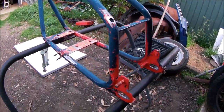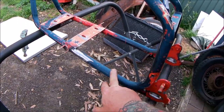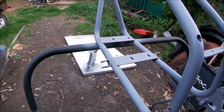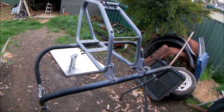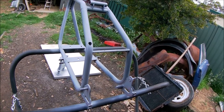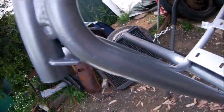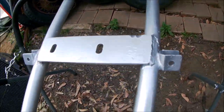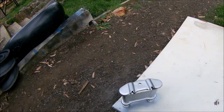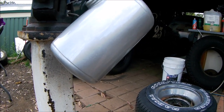Alright, it's time to paint — let's hope this stuff sticks. By the look of that it looks like it's acrylic the way it's sanded up. We'll see what happens. Light coat of primer — acrylic primer seemed to stick alright, so we can go on to the next coat. It's a three-part paint job, basically — it's a candy. Not including the primer, there's three parts. We'll whack the next one on and see how that looks. She went on nice — it's like a metallic silver. That's what color I'm going to paint the tank, so I won't be having the candy over the top. It came up pretty good. Now it's time for the color, and then the clear. Fuel tank's done, top coats and clear are on — lots of coats.